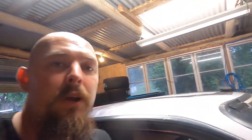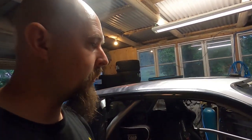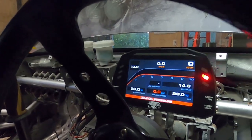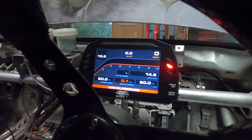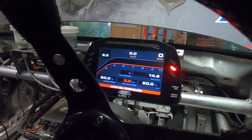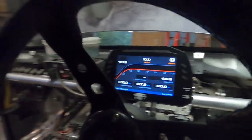Just went up to about 70 psi of oil pressure — going to let that drop back down to zero then let it pick up oil pressure again. Put the spark plugs back in and I'll be happy. Now on second cycle: 80 psi while cranking. Pretty happy with that. Spark plugs time — I think we're ready to fire it up.